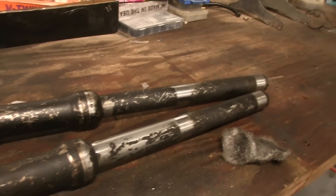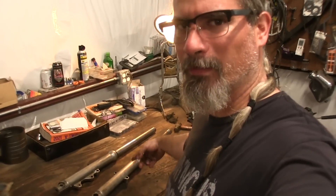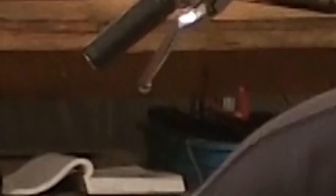I even got a set of fork tubes and sliders I bought off the internet a couple of years ago. I finally unwrapped them yesterday and some knucklehead had painted them black. I've been taking a little steel wool and knocking the black paint off — they could probably stand to have new seals and bushings put in them. With a little steel wool and some elbow grease the paint came off relatively easily. You don't want to paint your forks — they slide up and down into the sliders and that's not good for your seals.